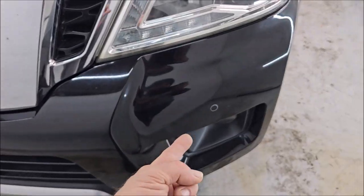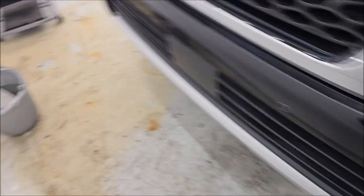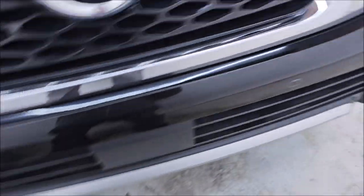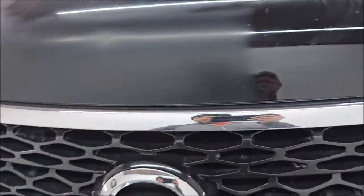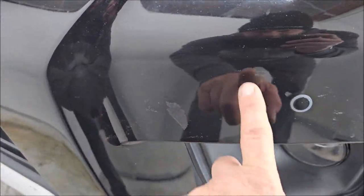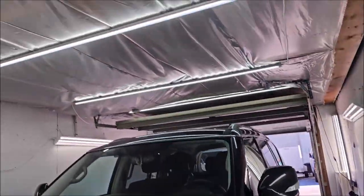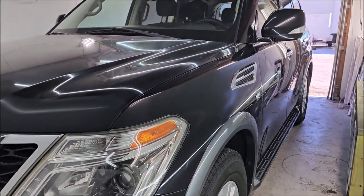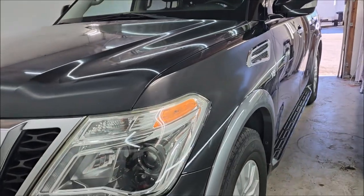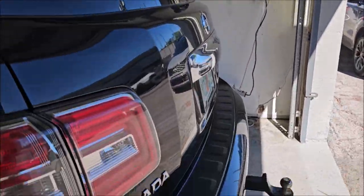What I'm going to do now is get under there and remove the sensors, then tape some stuff up and start sanding. I've got some 600 grit. If this stuff was worse than this I'd probably go down to like 180 or 220, but because it's not horrible I'm going to go ahead and not go real deep, except for areas like this where they've been touched up. This is my new paint bay — this vehicle is literally pushing the limits of my capability in this bay, but no problem at all. I've got room to work in the front, I've got my exhaust fans, but I don't have a ton of room in the back.